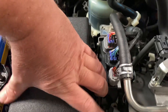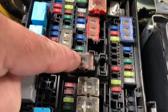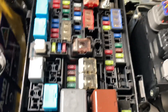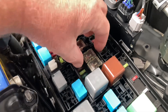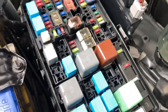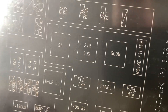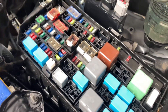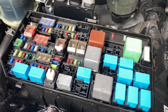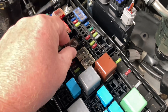Take care of all your grommets over here - make sure they're sealed up and wires go through properly. It's about time we started pulling these fuse box covers off to show you what they normally look like. This one has a 140-amp fuse and one has a 120-amp - so maybe at some point they upgraded, because this is a 2015. Earlier ones have the white 120-amp. The starter relay is still there - no air suspension relay because it's not a Kakadu. If someone in the comments said to pull the green one - that's your glow plug relay, not what they said. Follow the videos, not the comments.